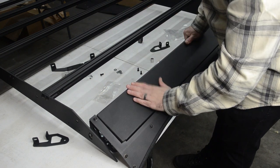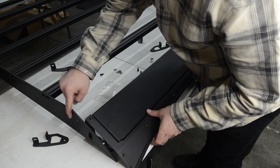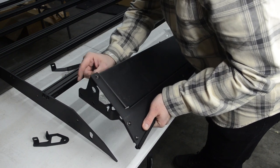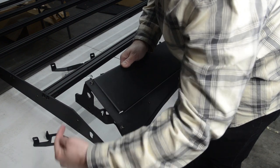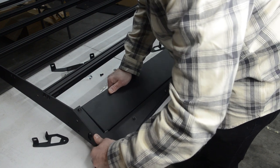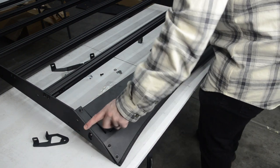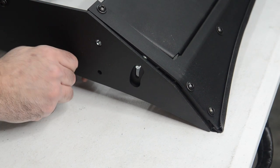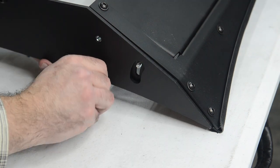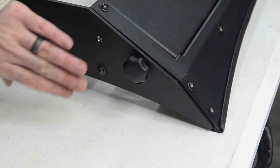So now that we have all the crossbars in place, next up we're going to attach the front valence to the rack. Essentially we're just going to put it into place. This bad boy attaches to this using two bolts over here on the side. As you guys can recall, on the actual valence bracket there are these little nuts already attached to the bracket. So all we need here is to use the bolts and washers from the outside in. This is a premium rack, so I pulled the knob off right here so we can actually slide it in through this provision right here. Once we're there, we're going to put everything into place and drive those two bolts in — do it on both sides. Then take our little knob, throw it back on.